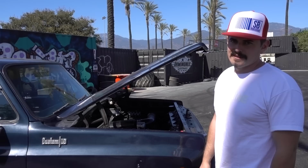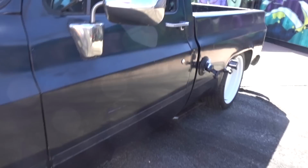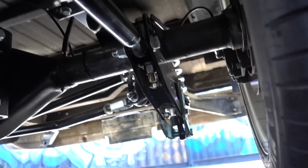That's definitely the cool thing about building American vehicles with American V8s. Suspension is all QA1 coilovers, all tubular arms, and every bushing has been replaced. The rear is the cool part, because they make this new torque arm kit. You basically get this whole torque arm style setup, like you would in a Camaro or Firebird. Then you can run coilovers in the rear without having a four link. You do have lower trailing arms, right?